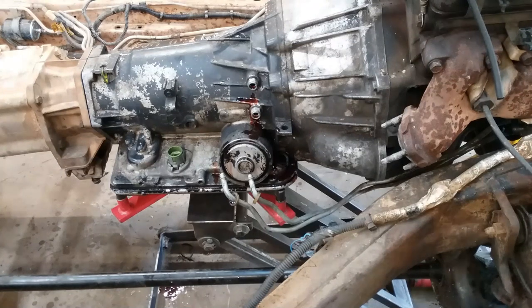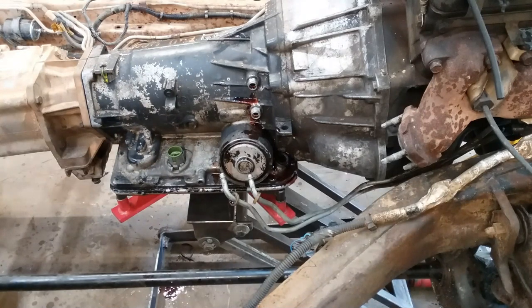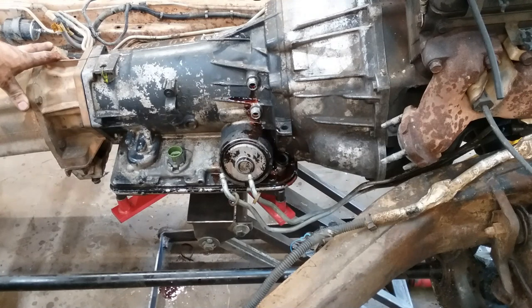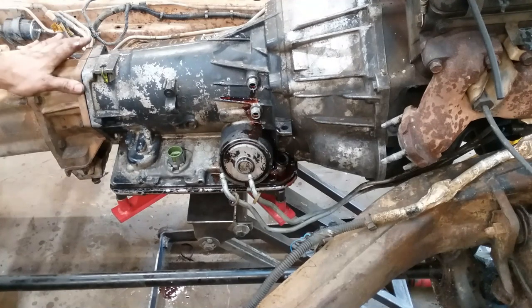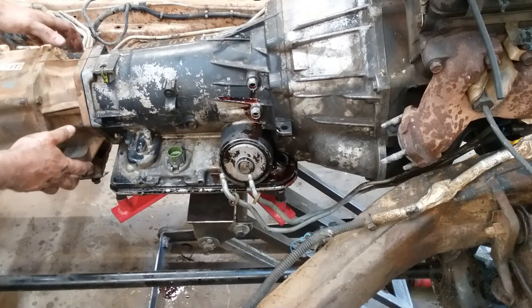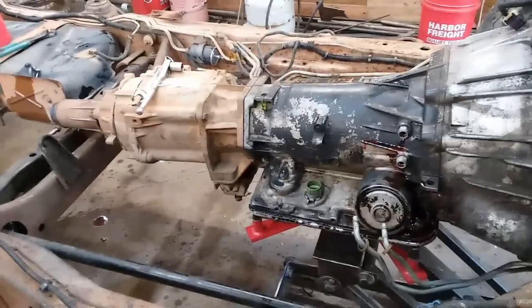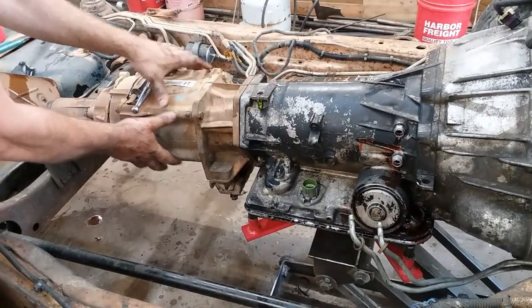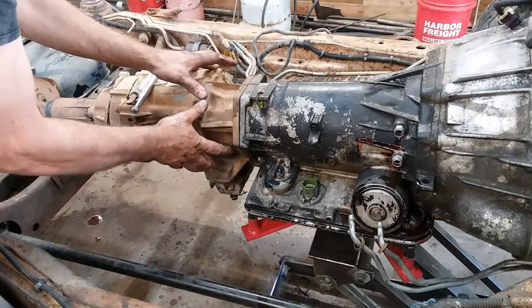We got that loose. I've got all the plugs unhooked from this, I've got the vacuum lines thrown out of the way. We're ready to take this transfer case out. Like I said, I typically do this from underneath — I take out all my bolts but two, have a good cup of coffee and go pee and do everything like that. And then I get up underneath here, take them two bolts out, and you just kind of pull her back, and it'll disengage from the transmission to the transfer case.